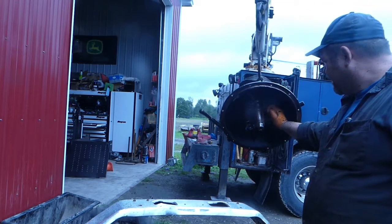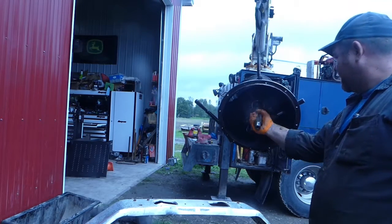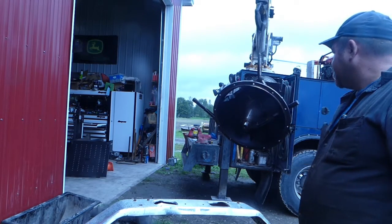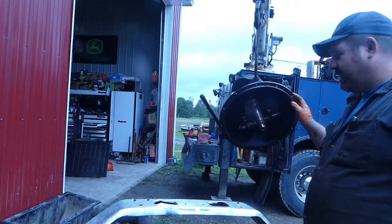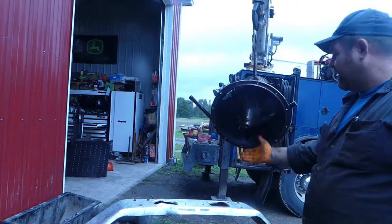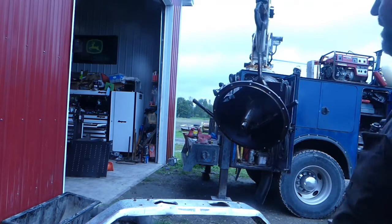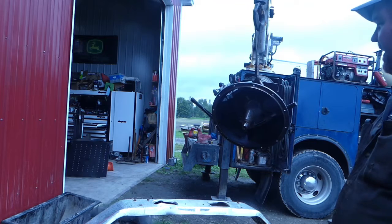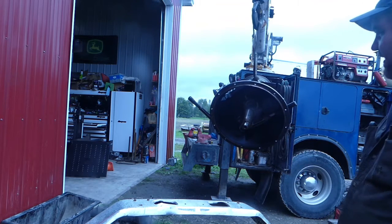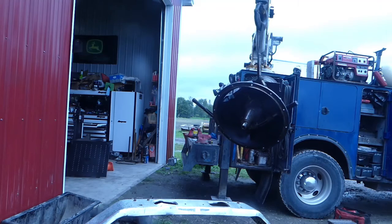Clutch fork, everything looks good. Nothing's bound up. The shaft looks good. Everything's clean. A little bit of brake clean on the inside of that, and it'll be spotless. So we're going to bring her over, and we'll set the new clutch in. It takes time to clean that stuff up, but it's worth it, I think. That way you don't have a slopping mess next time you go to adjust the clutch. So stay tuned. We'll be out over there.